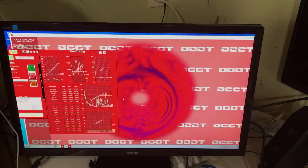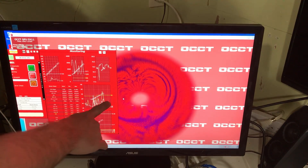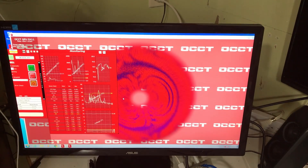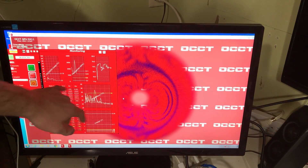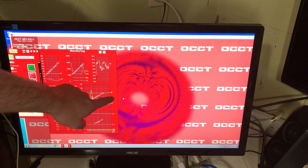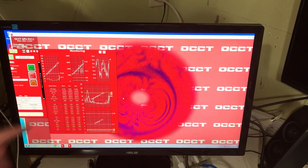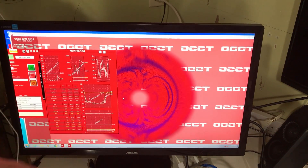To give you an accurate demonstration of how well this improved the card, it's running at 54 degrees Celsius right now — at max load. That is almost a 30 degree drop. It's leveling off around 54–55 degrees at max load. I'm really impressed.